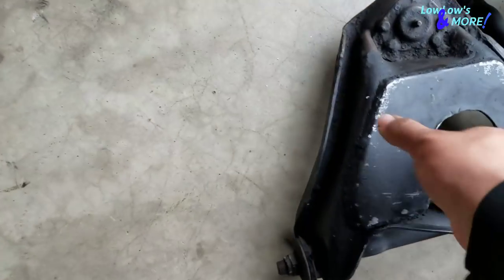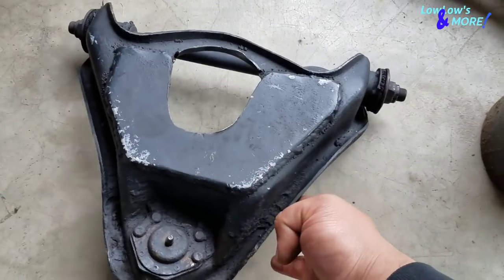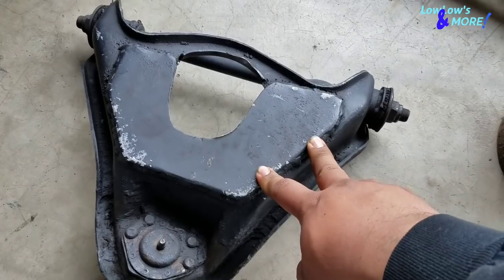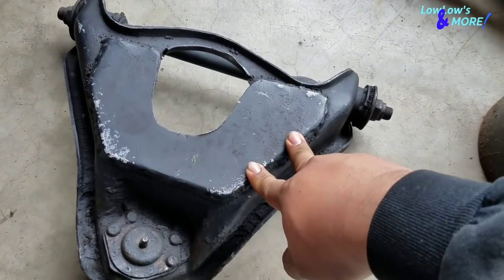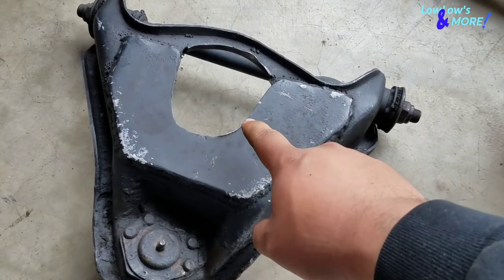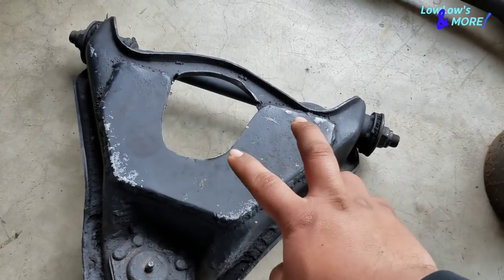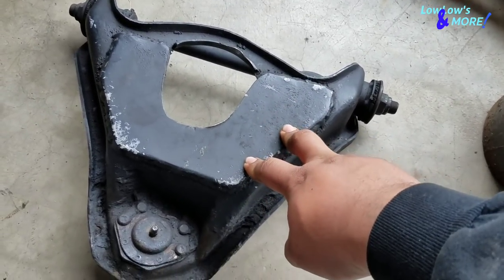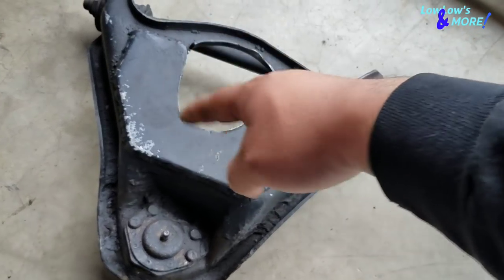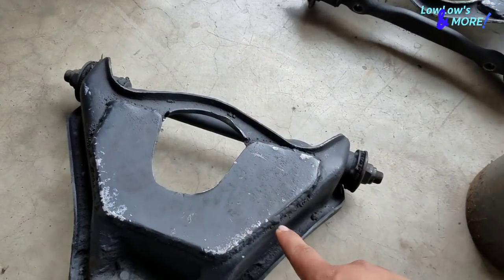Going back to the uppers - for any car, just remember: when I built a Caprice for one of my club members, since I had to cut a big hole for where the cylinder was going to sit, I ended up putting a plate on top just to help keep it straight without anything going bad. It was a pretty big hole, so that's why I kept this bridge back here to help keep it stabilized.